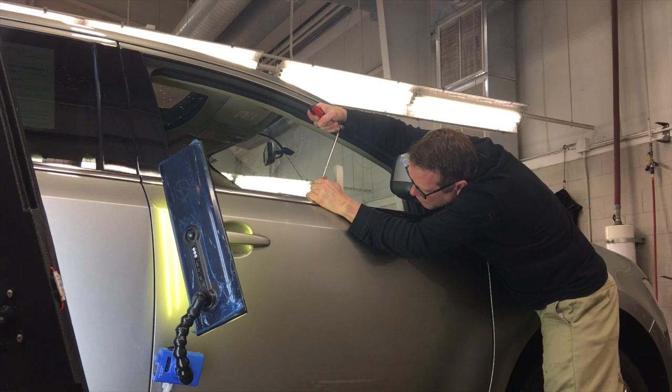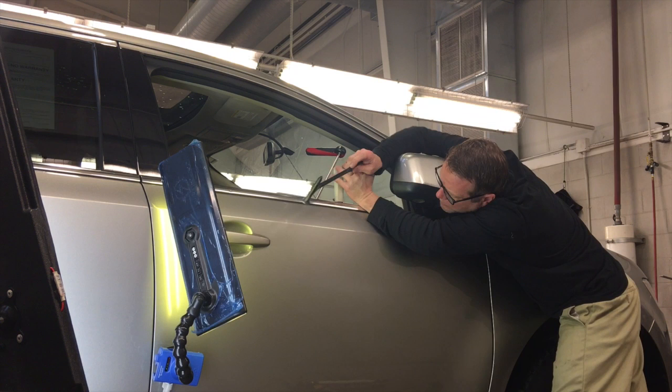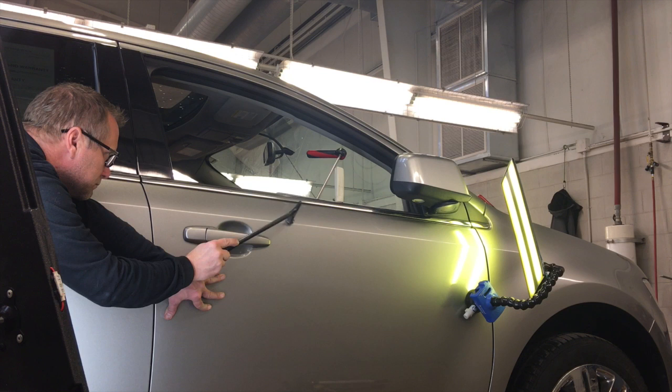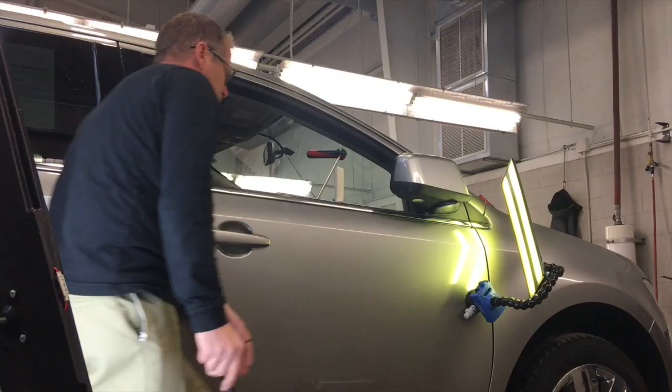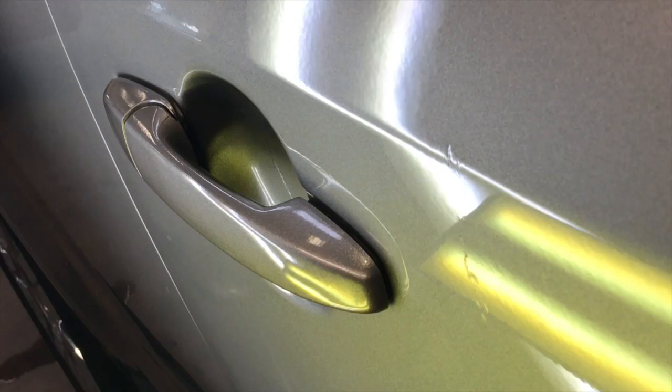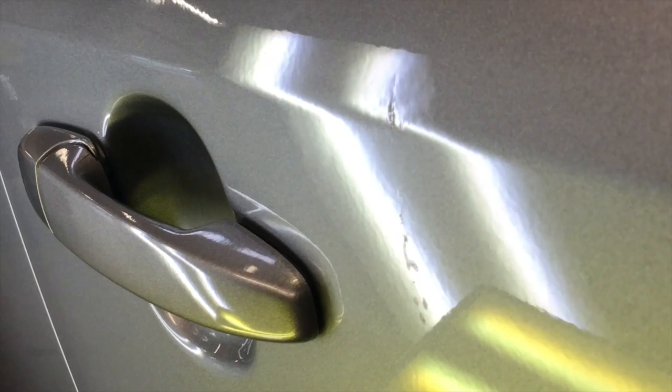I've moved on to a traditional mushroom metal head as opposed to the dipped plastic one I had before. You don't want to pump your dents — you want to push, hold, and release. Just staying on the line, opening up around where you're having crowns and it's holding too much pressure, then knock down a little bit more. I'm trying to keep it clean — I'm moving faster than I normally would with this repair. They got one on the house because I want to try to help you out. I pretty much called it a day at that point, trying to keep it nice and clean. Sorry this is a little long, but I hope this helped. Follow up with any questions.